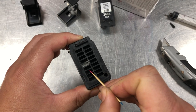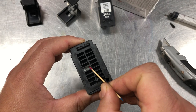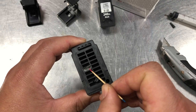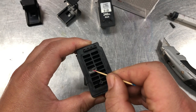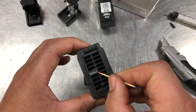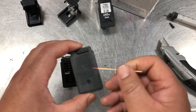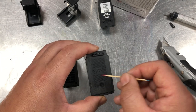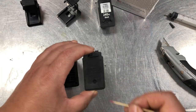Counting from the left: one, two, three, four, five — the air hole is the fifth one on the left. The air hole is right here; I've already sealed it on this one. If you take this kind out, the air hole is right here. Normally we drill the air hole to enlarge it so we can put the ink in — that's also your refill hole.